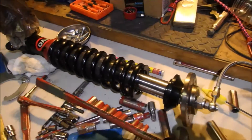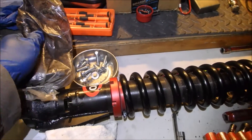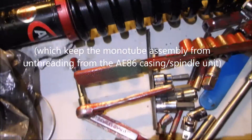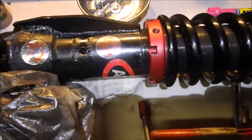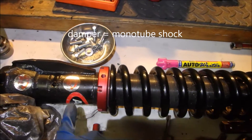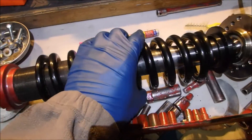The other option was — I actually talked to Darren over at MCN and he suggested that this thing has two set screws down in here. I've already removed them. The way these were assembled is that this damper is inverted and it is threaded in. I've already loosened up the collar and the spring is loose.